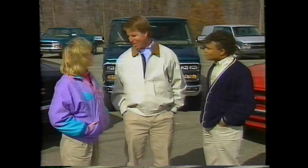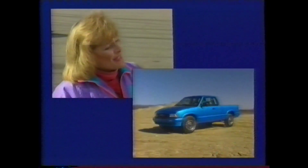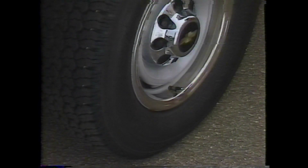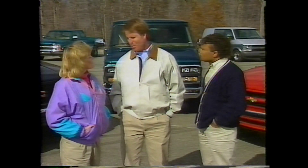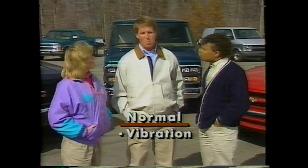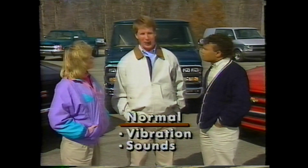Welcome back. So what did you think? One thing for sure, my new anti-lock brake system greatly reduces wheel lock, which can help me steer the vehicle. Anti-lock brakes can activate on many different road surfaces. Also, tire inflation and quality, as well as proper seating position, are just as important with ABS as they are with a conventional brake system. The most important thing I learned is that ABS gives improved steering control during hard braking, which can help stay out of accidents. Also keep in mind that sometimes the brake pedal may vibrate or pulsate, and as the ABS works you may hear some sounds and noises — all normal in anti-lock brake system operation.